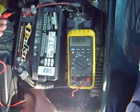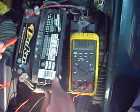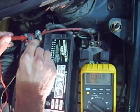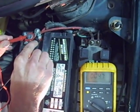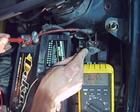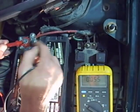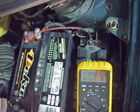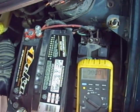That's where our voltage is disappearing — somewhere in the cables and lines we're using up more than a volt. We could break it down further: measuring from the positive battery post, only 47 millivolts are used up there, and across the entire cable from battery post to the next point, 55 millivolts. So not much is lost in that cable. We could break the whole circuit down to find out exactly where the voltage is being used up — perhaps it's in the headlight switch, which may be using most of the voltage.